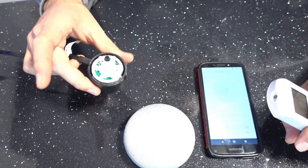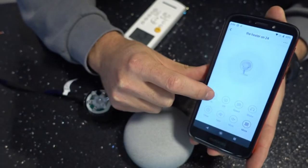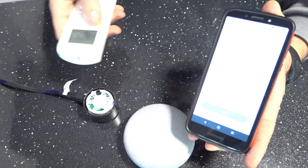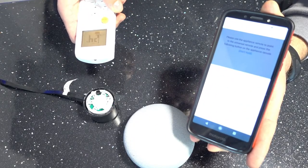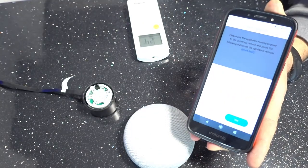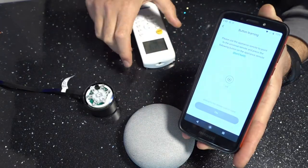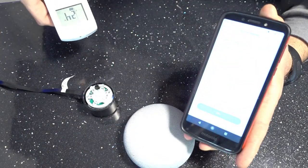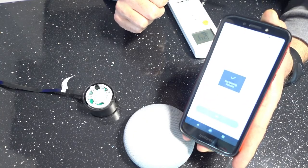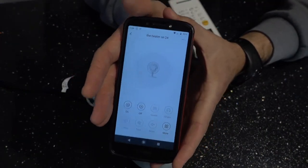When I learn the first button — the on button — you can see there's an on button in the app. I'm going to push on. It gives a warning that codes need to be learned and you have 30 seconds. I take the remote and push the button, and the Broadlink learned it. I click the power button, it tested against the unit on the wall — I click yes, it worked. Now I'm going to learn the off button. The remote is in on mode and it's going to send the off code. I click the button again and confirm yes. We've learned on and off — that's really all you need, the on and off options.